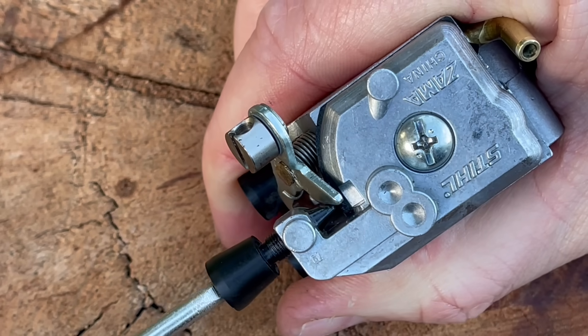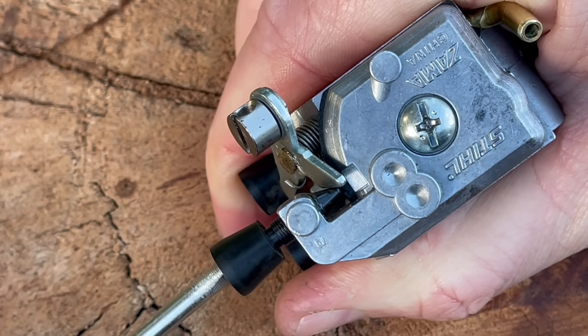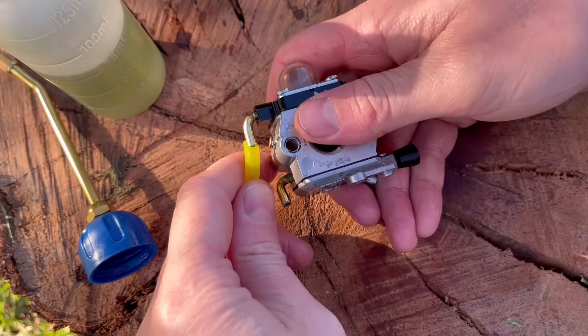This is really important to ensure that you've got full adjustability and control over the idle speed. The last step is to turn the idle screw in until it touches the cam in which it rests against, and then do one more full turn. This is a great starting place — you might need to adjust it when the engine is warm and when you're tuning it, but at least the engine will start and idle.